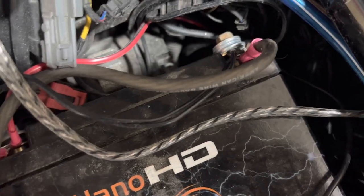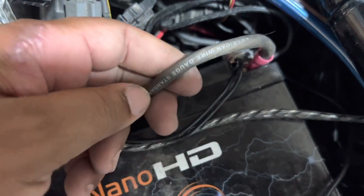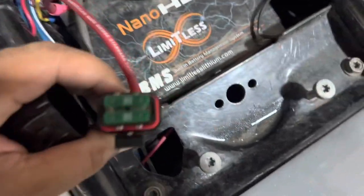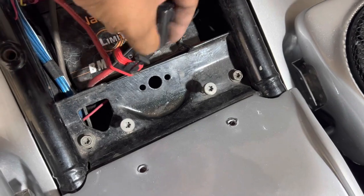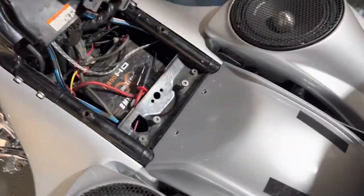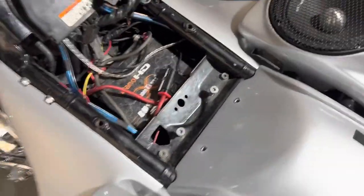I can live past that. I'm looking — there's only two power wires coming off the battery. There's two 8-gauge aluminum wires, so it's not oxygen-free copper, it's aluminum. There's the ground, there's the power. There's a small entry-level fuse block with two 30-amp fuses. That means this bike is fused for 60 amps of current. There's no other power or ground wires. You have to remember — 60 amps gives you 800 watts.